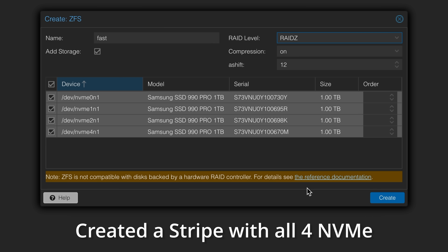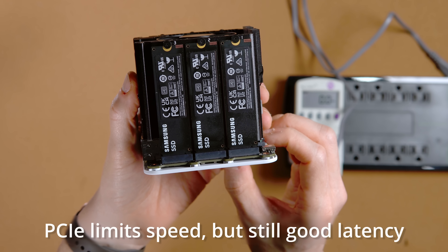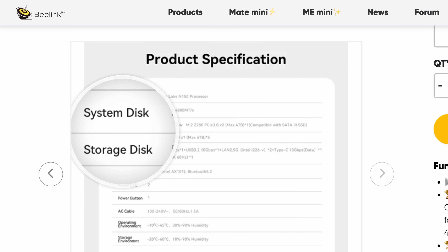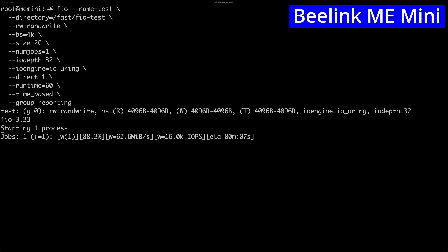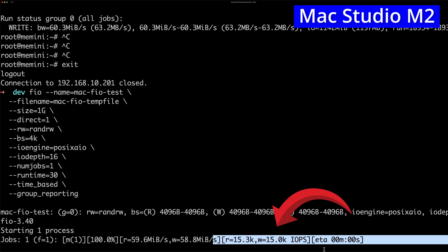With Proxmox running smoothly, I created a ZFS pool using four Samsung 990 Pros. I went with one big stripe without redundancy — most people aren't going to do this, but I'm not most people. I wouldn't use fast NVMe drives like these, and that's kind of why I think this device is a little odd for a NAS. NVMe drives are more expensive than traditional hard drives and even SSDs, and on top of that we're leaving a lot of performance on the table because these only run at PCIe 1x Gen 3. I'd look for the cheapest ones you can find. That said, a quick test on my pool showed around 15k IOPS, which when I compared to the IOPS on my Mac Studio M2 was almost exactly the same — pretty decent all things considered.